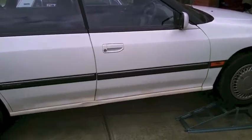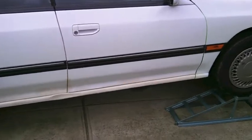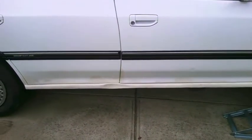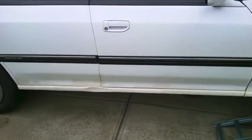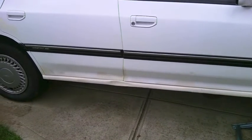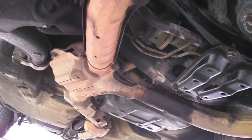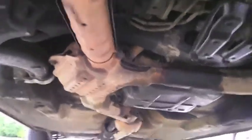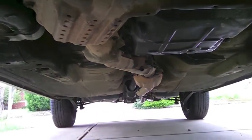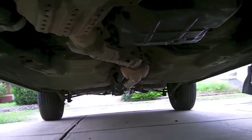As you can tell — I don't know whether the camera microphone will pick that up — but there sounds to be a fairly hefty leak coming from about the centre of the car, sounds about the same on both sides. So we'll just have a quick crawl underneath and see if we can see or smell any exhaust leaks. It appears to be coming from around the CAT converter from what I can hear.